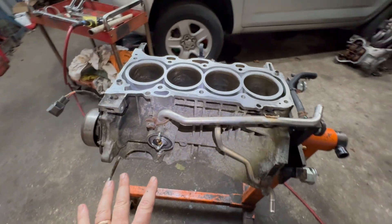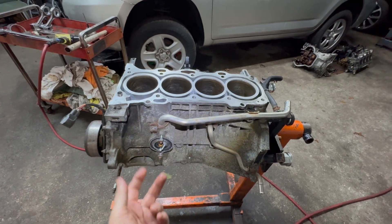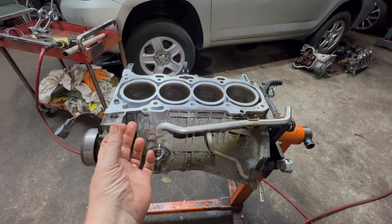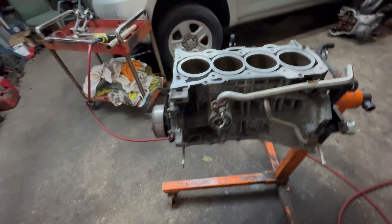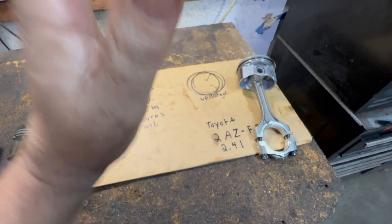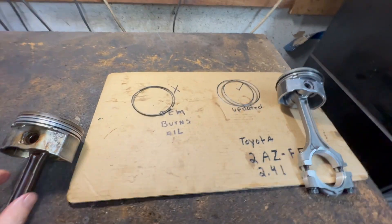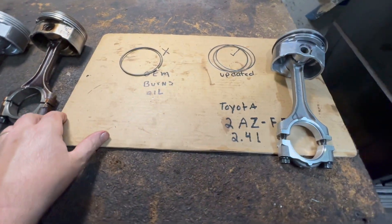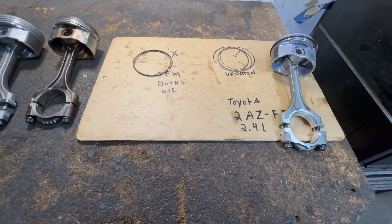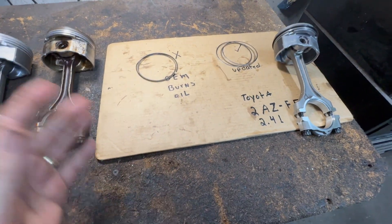There's really no room to do it, so you have to pull the engine out of the car just to replace the rings. Years ago, with the other style, when you dropped the whole pan you could see the whole crankshaft, get to the rod bearing bolts, and take the pistons out. Those days are gone. Now you have to pull the engine out. If the car has low miles and is in beautiful condition, it's worth doing — it's never going to burn oil again, and Toyotas can last a long time after these defects are fixed.